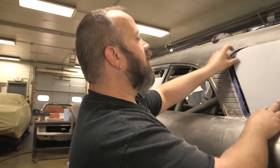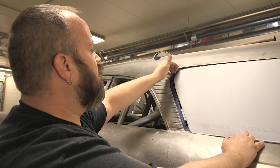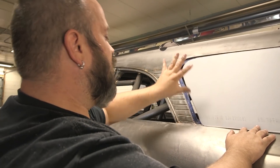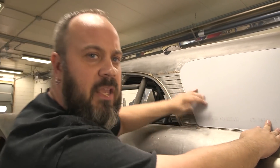You may have seen certain cars where their windows blew out once they got to a certain mile per hour. If air is getting into the car, it's got to come out somewhere. Either you make a car that's nicely sealed up like we are, or put exiting holes in the back so air can get out. Outside of this flange, this side window shouldn't need any more support. There are people that might put vertical supports and maybe a couple more screws, but being as short as this is, it'll be plenty rigid. Plus this is three-sixteenths, not one-eighth, so it's even thicker than we really need. That's basically how it's going to be fastened — a process of sanding and massaging, and we'll start drilling a couple holes to hold it in while we work the whole piece.